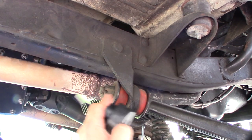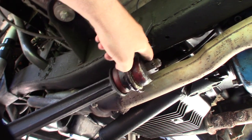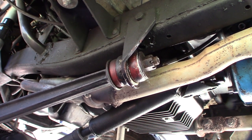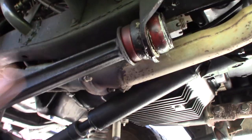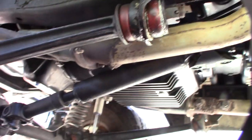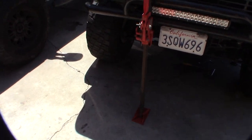It just made more sense to have these things sitting in a rested, angled state and not under load. So I'm gonna take the old ones off and get these on. This is the actual problem side — I can't get good pressure on it even though the nut is totally cranked down. I'm getting a popping sound on this side, like when I pull into my driveway pop pop, and I also get a little shake up in the front. I get the cotter pin off and try to push this out — sometimes I have to take the drive shaft off to move it forward enough to get the new one on.